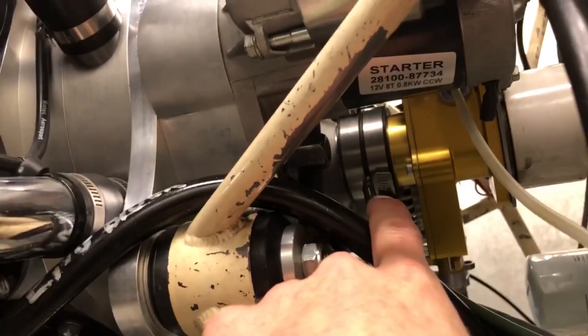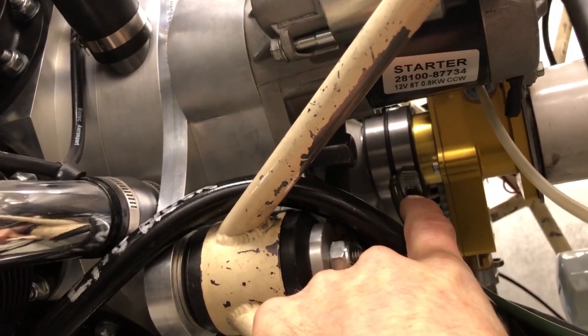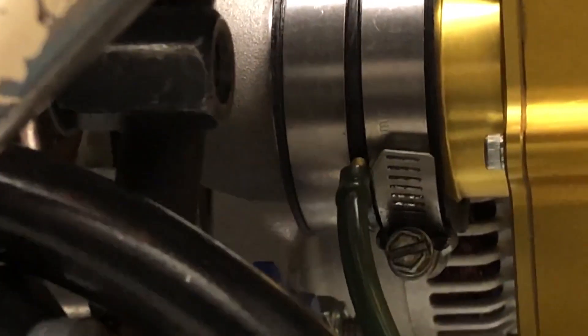Right in between the coupler — this coupler won't come with the engine, he'll get a brand new one — but what I've done is snuck a little brass pipe in there. Right in between the two hose clamps I've pierced a one-eighth inch, three-millimeter brass tube, fashioned a barb on one end, and on the other side I've soldered a washer and flared it so if the solder breaks it won't go into the engine. That is actually a manifold pressure port. You could drill and tap the TBI on the aft area or the manifold itself, but this is good enough and there's nothing wrong with putting it on an airplane like that.